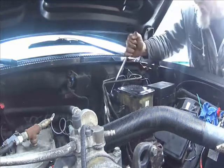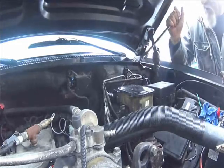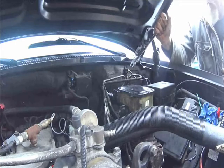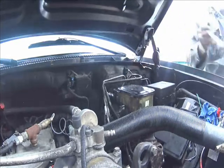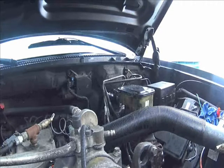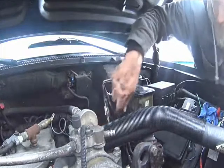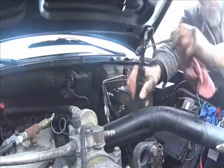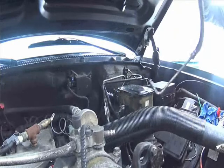The hydro boost helped. They say they don't have room in here for a brake booster. I bet you there is — I mean, they sell small custom ones, but if the truck doesn't make enough vacuum you really can't run one. That's tight. Let's get this old one out of here. Come on. There she is.